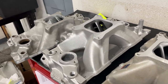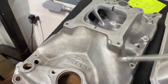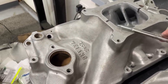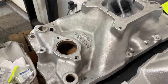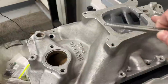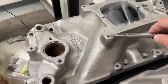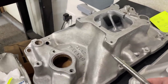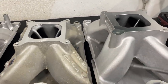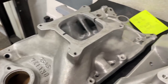One of the other major design changes is the height of these manifolds. When the early ones first came out, I bet concerns about hood clearance kept the carb pad lower — but keeping it lower really limits you in terms of runner length. Runner length is one of the key things that makes power from a manifold, and you need to tune it for the RPM range you're going to run. If you make the manifold short, the runner can only be so long. As things progressed and height increased, it became easier to get a better approach angle and longer runners.